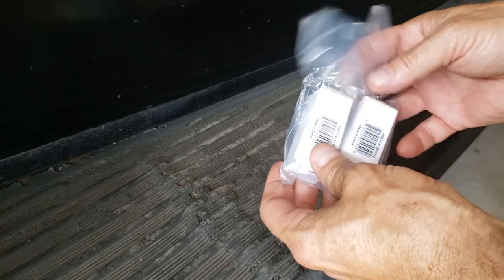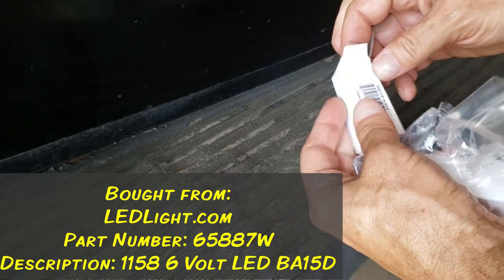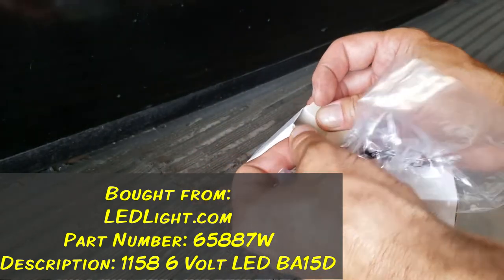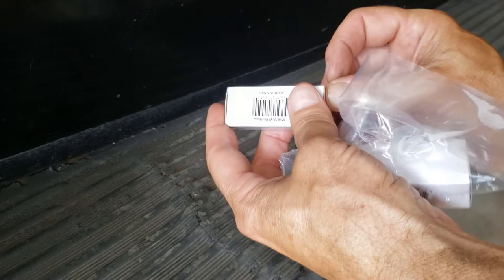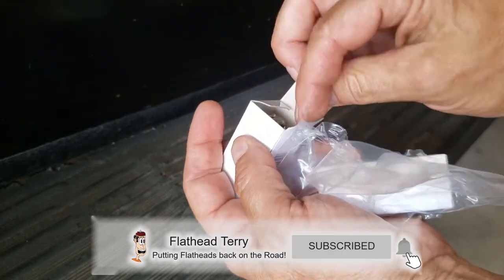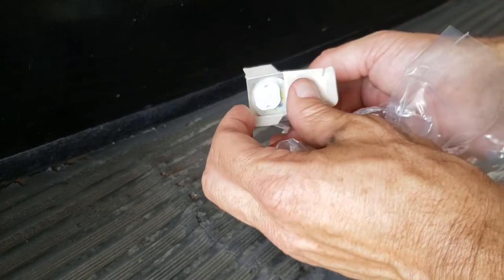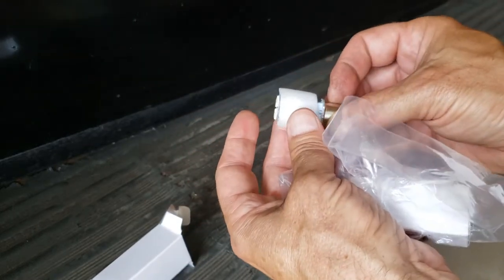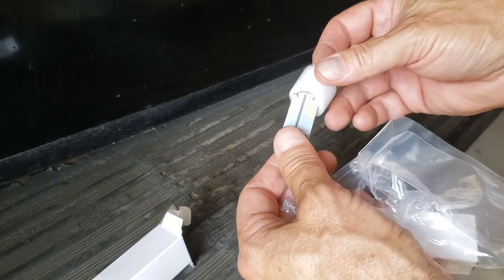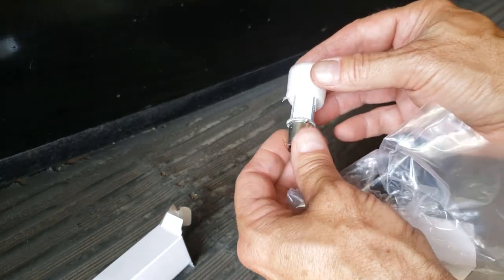I ordered these off the web — there's all kinds of manufacturers that have them — but these are six volt, they're 1158, the GE number 1158. I'm going to carefully take it out of here without damaging it. Let's open it up from the bulb end here — there we go — so we can kind of push it out carefully. It's got some nice protective foam on there. This has about 400 lumens, compared to the incandescent one which is around a hundred, if that much.